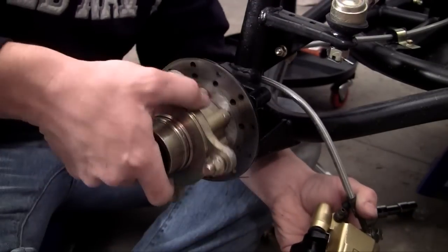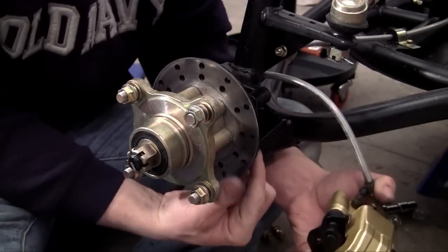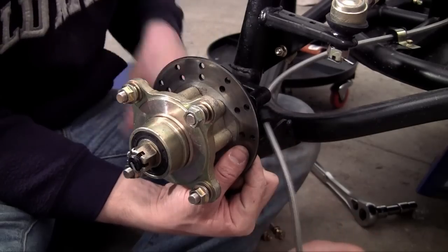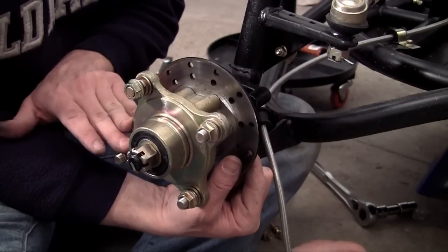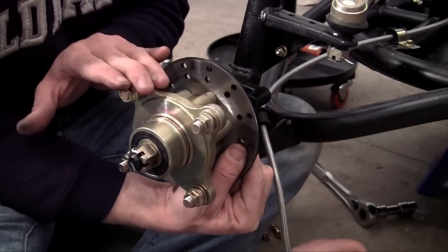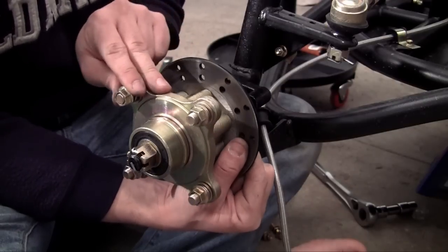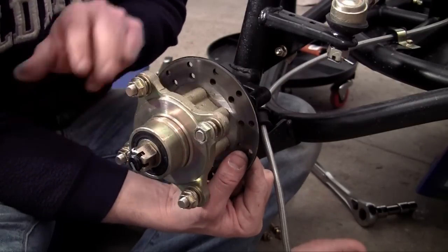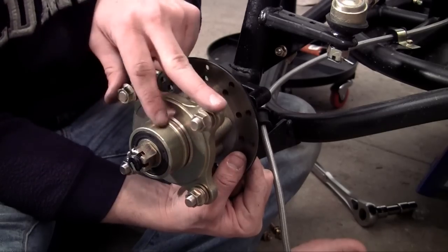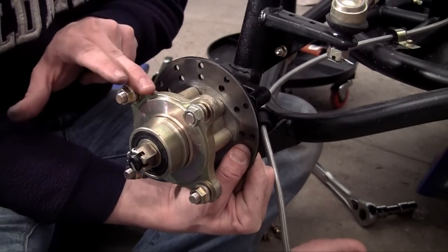Now of course, you're usually going to hit your brakes when your go-kart or car is moving, and these brake pads are going to go over this rotor. So whenever they're spinning like this you're going to be good, but then whenever they pinch together, this rotor no longer spins, and since this rotor is connected to the tire, your go-kart is going to come to a stop. So pretty much the caliper's job is to tell when the brake pad should pinch together — foot on the brake, they pinch together, go-kart stops moving.